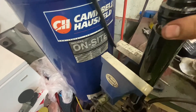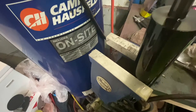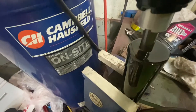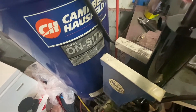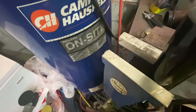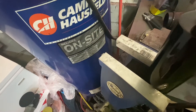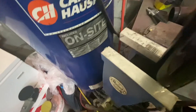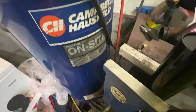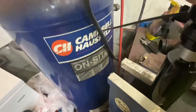Move the seal up. Try not to push it down too quickly. Now you're going to pump it a couple of times to get all the air out. If you did it well, there shouldn't be much. Just make sure your strokes don't come all the way back to the top, because then you'll have to start over again and there will be a lot of air underneath it.